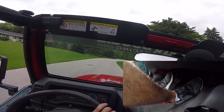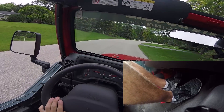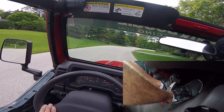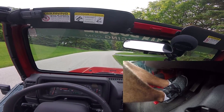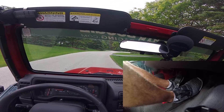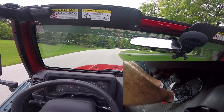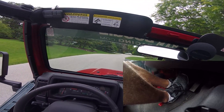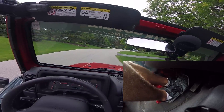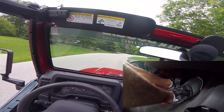That's going to take some time to get smooth. What happens is if you let the clutch out too quickly, the engine's going to die. You can kind of feel how it just wants to die. So basically, when you feel or hear the sound of the engine kind of dying, all you've got to do is just give it a little gas — not a whole lot, just enough. And if you feel like you're going to stall and the car starts to shake, just slam the clutch in real quick and you won't stall. You can actually save the car from stalling even if you almost think it's going to stall. You can still save it.